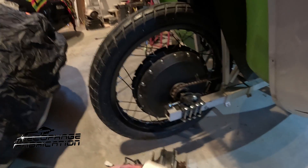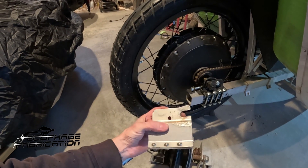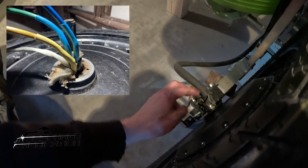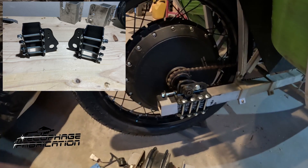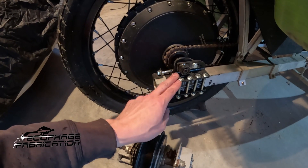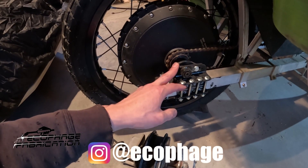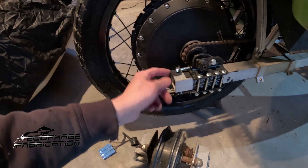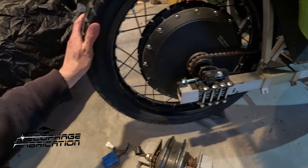The biggest thing we had to address was the fact that the original brackets were not made to handle this type of power. They're aluminum and they bent pretty quickly, and when they bent they actually damaged the cable. So first thing we had to do is repair the cable — strip it all the way down and repair the damaged wires in here. Then we went ahead and fabricated up these brackets. They're internally slotted but not open, and they're made out of steel, so they're a lot stronger than the original brackets. Because this is a motorcycle motor, motorcycles have chain tension and e-bikes don't, so we added this tension bolt so the chain can actually be tensioned and this wheel doesn't slip at all.